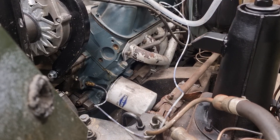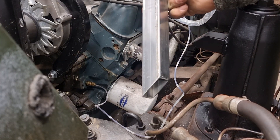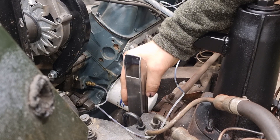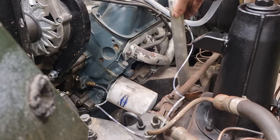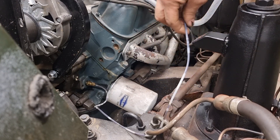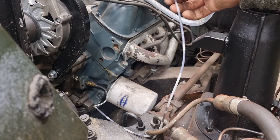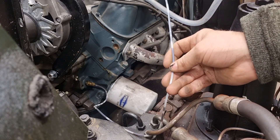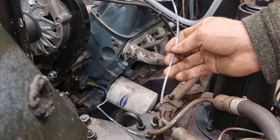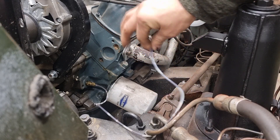There's one bracket for the electric pump, here is the other one. I will weld that over here and I will make a third one in the frame. This oil pressure line — I'm ordering a copper line instead of this plastic, which might get brittle over time, melt and break. I don't like this at all, this is just temporary.